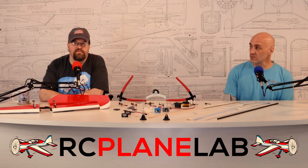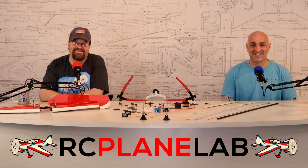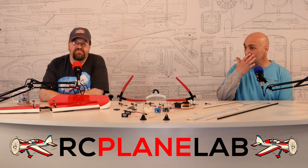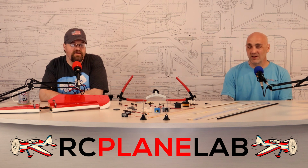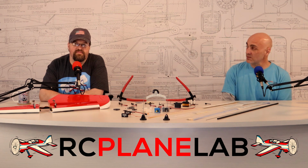So we don't want to set up any binding, and we certainly don't want to develop any slop, which brings me to my 6th and final rule. Finally. Avoid the slop, right? I mentioned a little bit earlier that easy connectors can wallow out the hole, introduce slop, and then you've got a weird setup there. Just avoid the slop whenever possible. You want to make your connections as tight as possible.